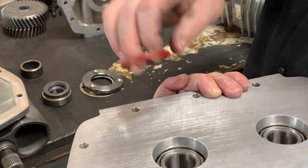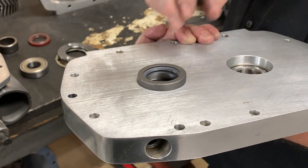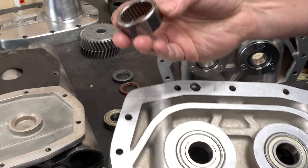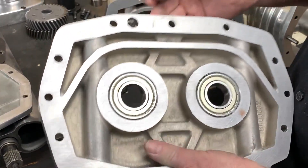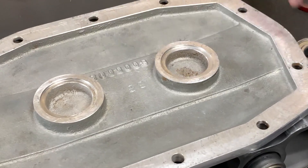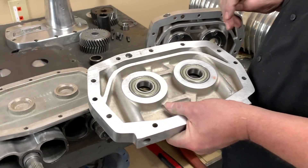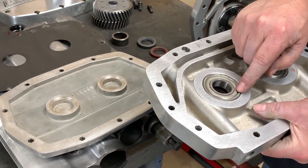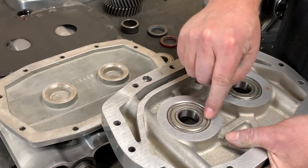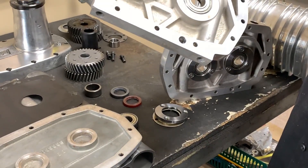We also got the back machined. Here's the original B&M seal — you can see it falls into this one — but now we utilize our seal, so it's been re-machined and that'll get pressed in on final assembly. We've got our rear plate done. So now instead of the original roller needle bearing, we have it machined for our bearing and our seal. One thing we did notice is this rear cover's diameter is actually the same as the bearing diameter, so it has to make contact with the bearing to properly seal and keep the grease in the rear bearings. What we did was leave this bearing up just a few thousandths during machining so it'll be slightly higher, and when this contacts the gasket it'll give a positive seal around the outer race of the bearing to help maintain the grease long-term.